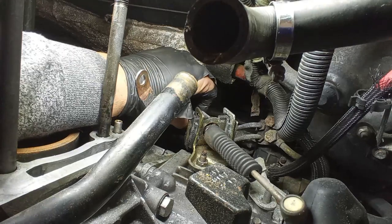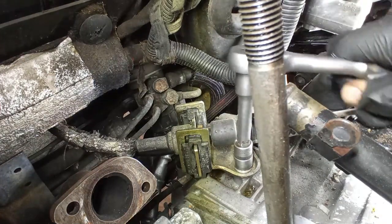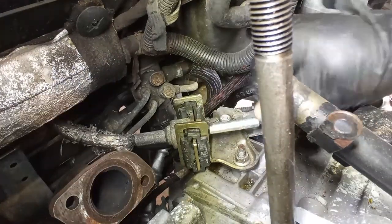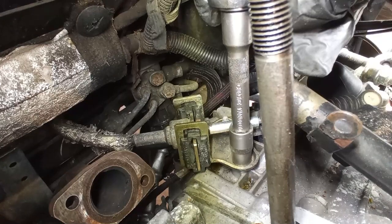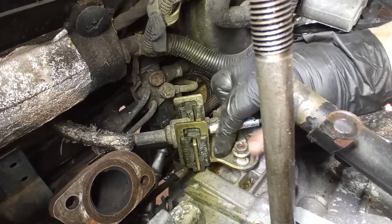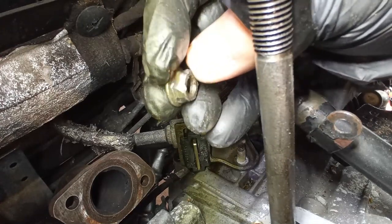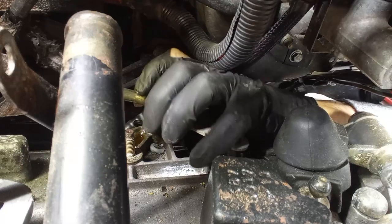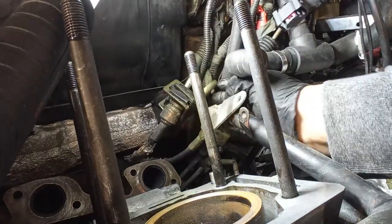On my case I have to take out the entire support for the cables, so I leave both procedures so you understand how to do both. It's out, and now I understand the cable is not flexible enough to be removed. Here I have three 13mm head nuts — the second is not existent, the first is all messed up, and the third one is good. With a bigger 13mm socket I try to take out the nut. As you can see it's all mangled up. So much fighting over a nut. Now I take out all of the support assembly for the cables, and once again I position the wire loom so that when the engine is coming up it does not foul on anything.